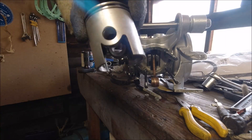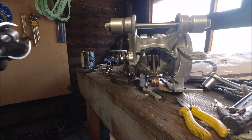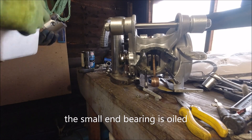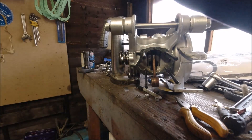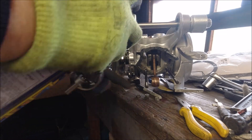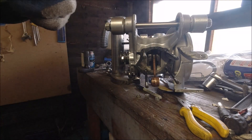I'll just put a bit of heat on it — don't go mad. I need the wrist pin now. I'll start putting the wrist pin in — it should just slide. I'm going to put a bit of WD-40 in on the little end bearing. Arrow down, of course — I would put the wrist pin in the wrong way otherwise.